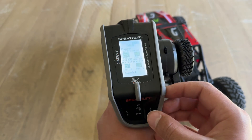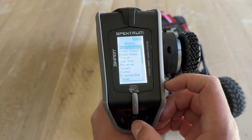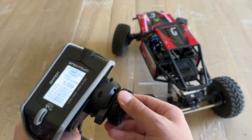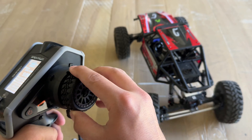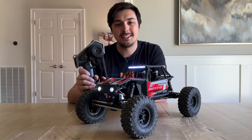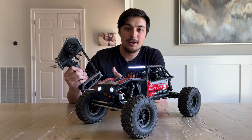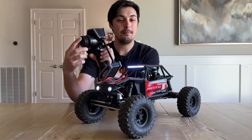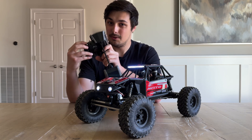With that, we're pretty much done. Hit Clear to access the menu, then Back and Clear again to go to the main screen and hit Okay. At the top you can see our front steering servo, our mix for opposite steering, our crab mix, and lastly our rear steering servo. That covers the four-wheel steering setup with the new DX6 Rugged. This is aimed at people who may never have had a computerized surface transmitter before — it's really nice having four-wheel steering with a proportional setup as opposed to just a button on a ready-to-run transmitter. Thanks for watching, and we'll see you on the next one.